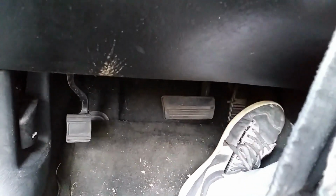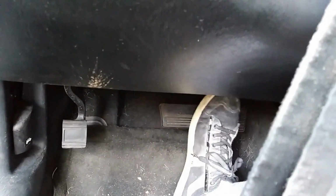And the last thing you do before you jack the car down is you want to pump the brakes. Now, I usually do 3 to 4 pumps, not all the way to the floor on the first 2, but you do that to make sure your brake pedal is back up and good. Every time you change the brakes on each wheel, you want to do that. That's it, and job done.